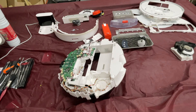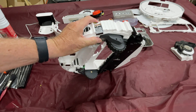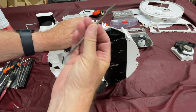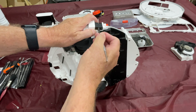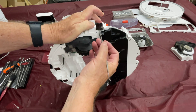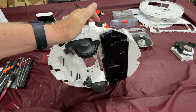With the cliff sensors, you can push and poke them all you want but that doesn't remove them — they seem to be locked in place quite firmly. But there is a simple trick: you need a flat tool, possibly a screwdriver, and from the underside just push. Did you see that? I'll do that again — just get a tool between the frame and the sensor and push, and that unlocks it. Easy as that.